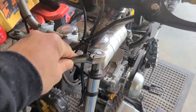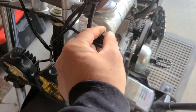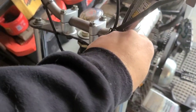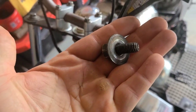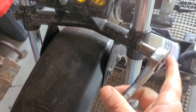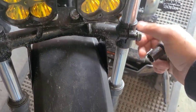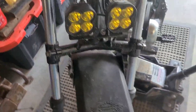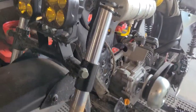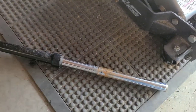A short 14 gets me right up in there. These bolts are torqued, but once they're popped they should twist right out. That same 14 is going to work on these bolts as well. I'm just going to loosen them up, and I should be able to pull these tubes out — just like that. I get the other one and get them up on the workbench.